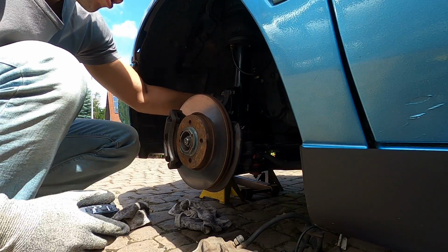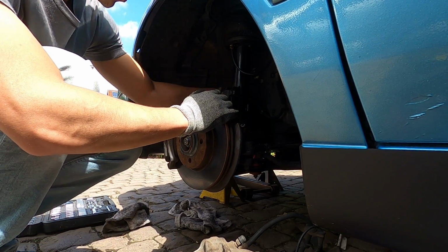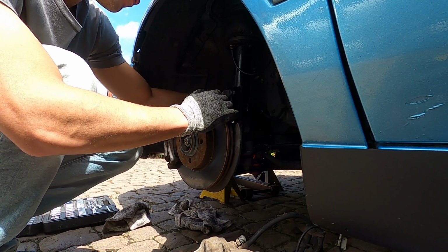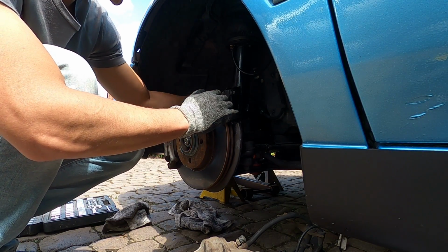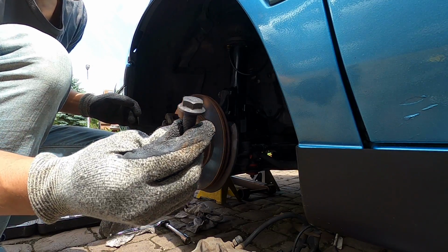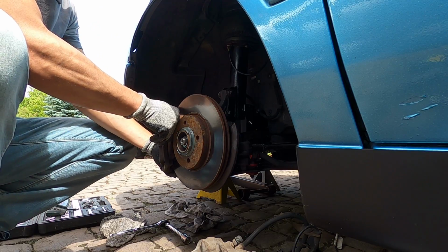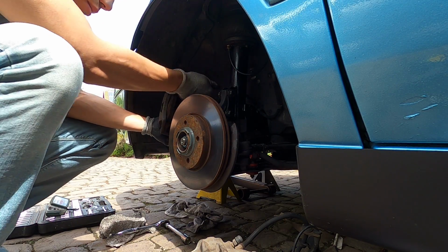Pull that out, whole thing comes off, and then go ahead and swap on our new fancy stuff, which I hope everything works. Everyone told me it's a direct fit, but things always seem to get messed up somehow. So hopefully everything works out exactly how it should. All right, we got both of our 17s out of the way. We're gonna go ahead and slowly pull our caliper off. That easy, and we'll go ahead and pull out this bracket.